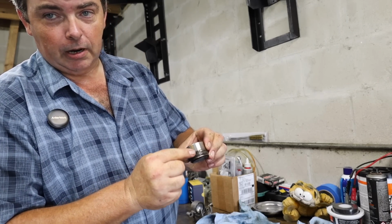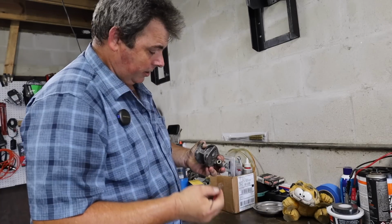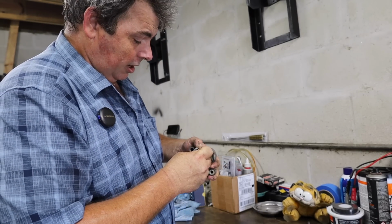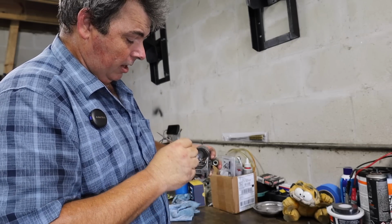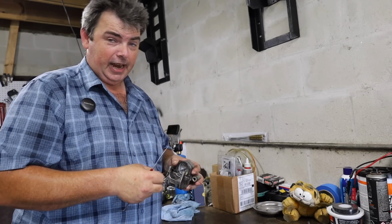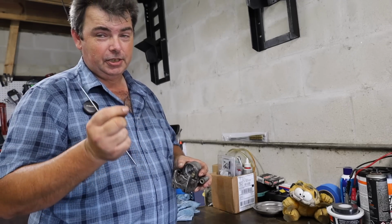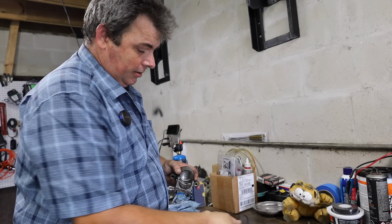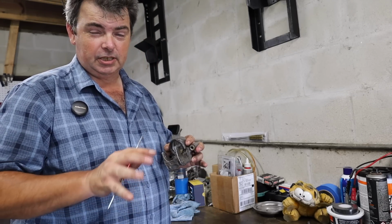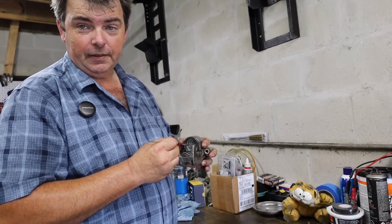This entire shiny part of this brake piston, this is all the sealing surface for this rubber seal that's in the caliper body. Take our caliper, we'll take our little hooky pick here, and there's going to be 2 sealing rings in here. Usually on most calipers, the one closest to the outboard side of the caliper piston cavity, if you will, that's going to be a lot thinner than the one on the inside. The reason for that is this doesn't seal any fluid pressure. This is predominantly strictly just a dust seal. It's so thin that it's really not going to do any kind of a job sealing fluid pressure. It's simply there just to keep the crap from getting into the caliper, contaminating and compromising that hydraulic seal that's deeper down inside.